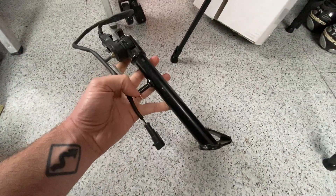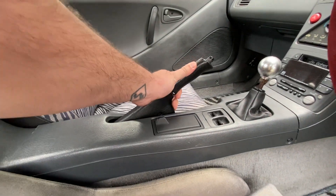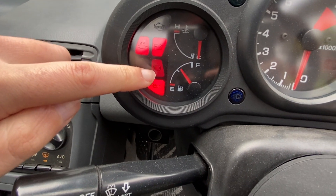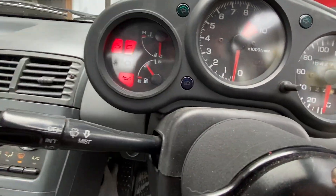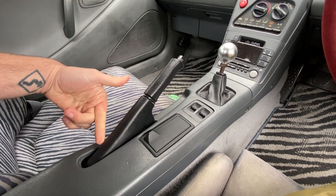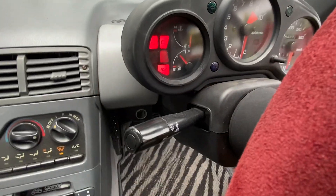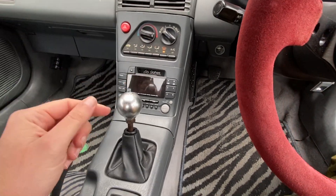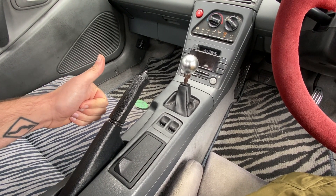Another mystery was what to do with the kickstand and this kill switch thing. Well, that's where the handbrake comes in. When you turn on the car, there's this little light that tells you that your handbrake is on. So if you put the handbrake off, the light goes off — on, off, on, off. So I could just hook up the kickstand switch so that when the kickstand is down on the bike, this would be rotated up in the car so that the light would be on. And that's actually a legal requirement to have the light on. I'll just move the light somewhere else on the dash. Thanks to all the people that had that idea in my comments — you guys are geniuses.